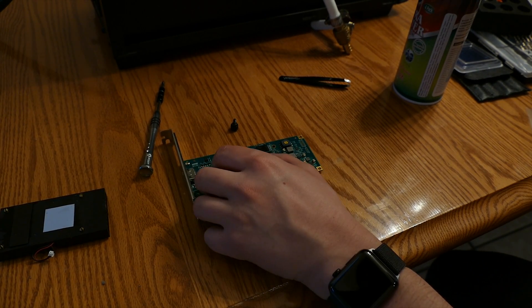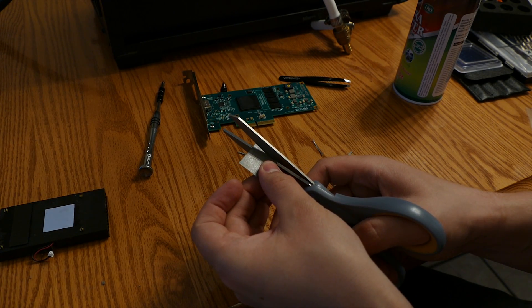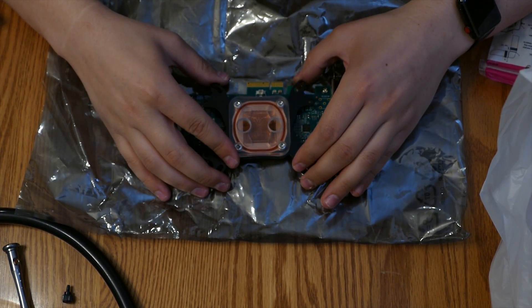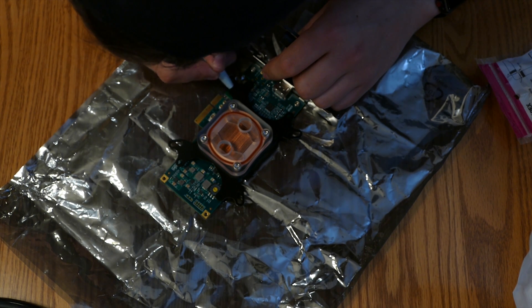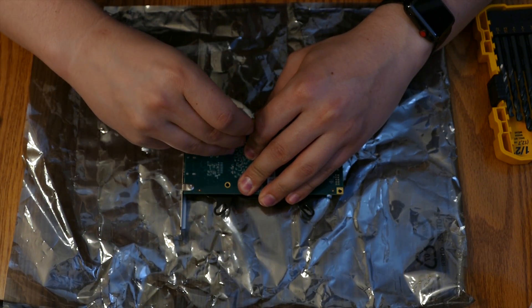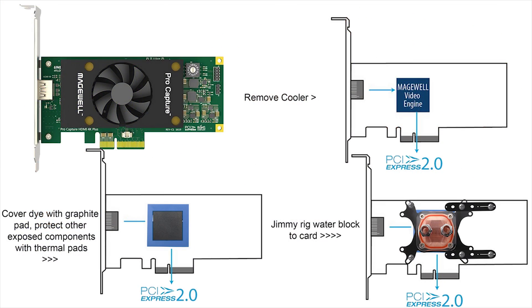The chip was quite a bit smaller than the graphite pad I ordered, so I needed to cut that down a bit to get it to fit just right. I don't want it hanging over the main chip at all as it's electrically conductive. After cutting the graphite pad to the right size, I set the water block on top of the card to see if it was in fact a perfect fit, and just as measured in Photoshop, it seemed to be. So I began to mark where to cut some of the metal off of the water block so it wouldn't protrude past the PCIe connection. Then I flipped the card over and used a drill bit to mark the metal wings on the water block through the holes in the back of the capture card so I would know where to drill the new holes. This was going to work much, much better than I originally imagined.